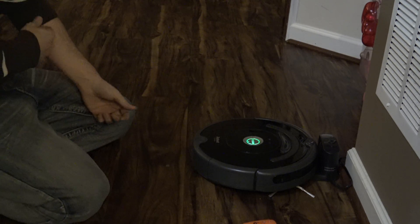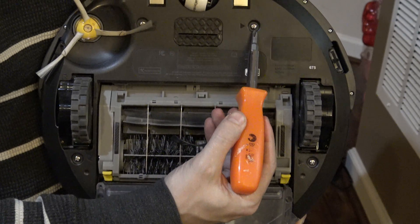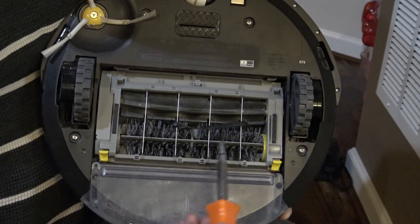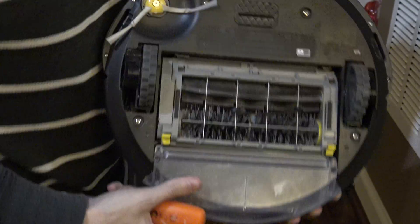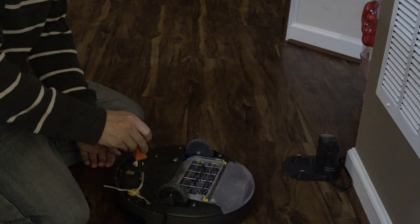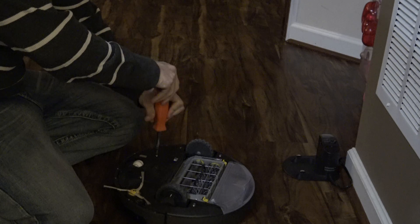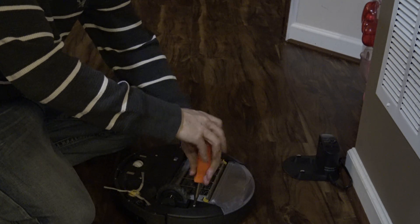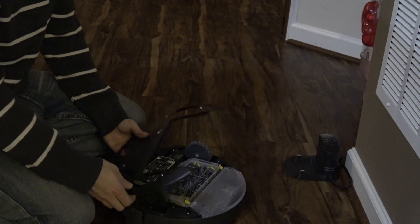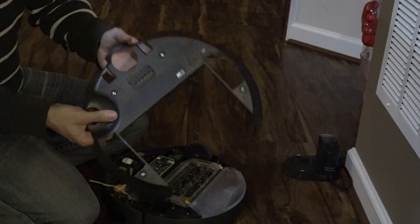To fix the next part you have to actually get to the battery. For the 685, there are four screws — one here, here, here, and here — and this whole lip will just come right off very easily. The screws don't actually pop out; you just unscrew and loosen them and the bottom panel will come right out.